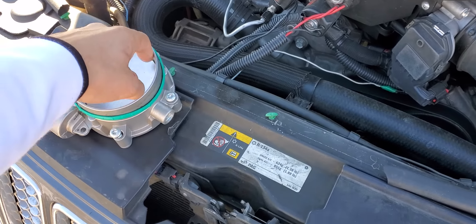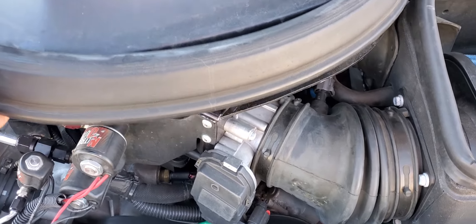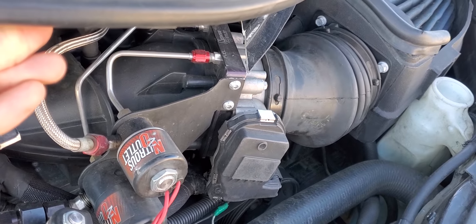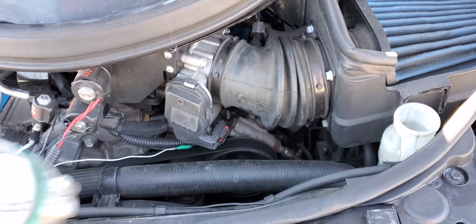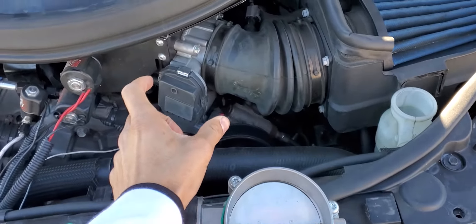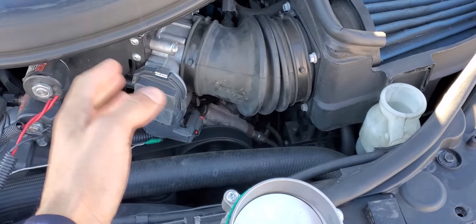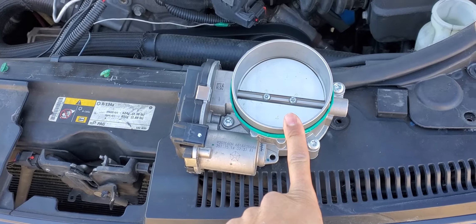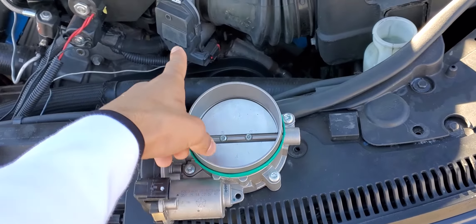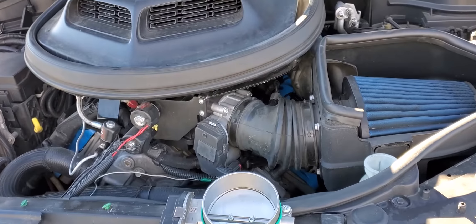One thing I can port out to match the adapter is the mouth of the intake manifold. I have the intake manifold here with a nitrous plate attached. The problem is I don't think I'll be able to fit both the adapter and the nitrous plate on the intake manifold — there's just too much material bunched up in that area. There's not enough room to add another one or two inch block in between everything, and then also fit the Hellcat throttle body on top.